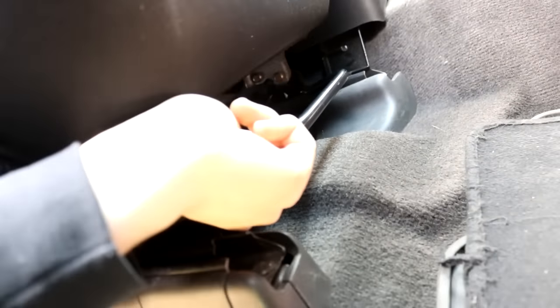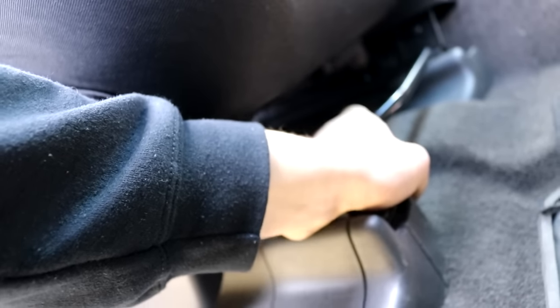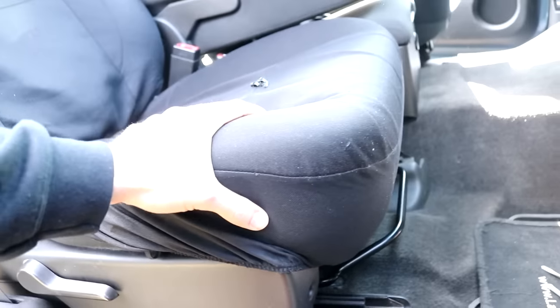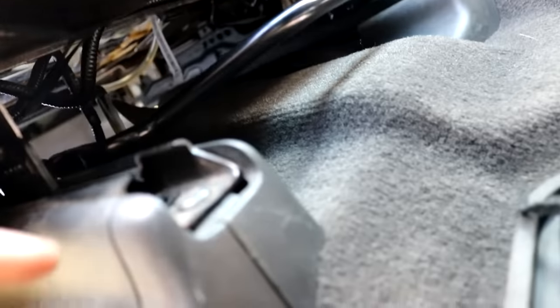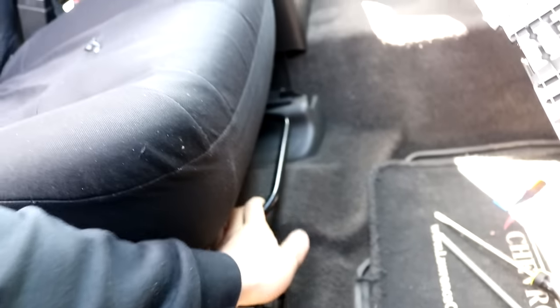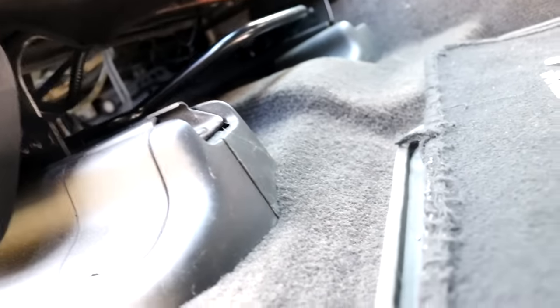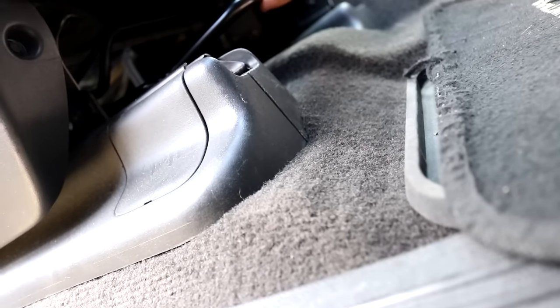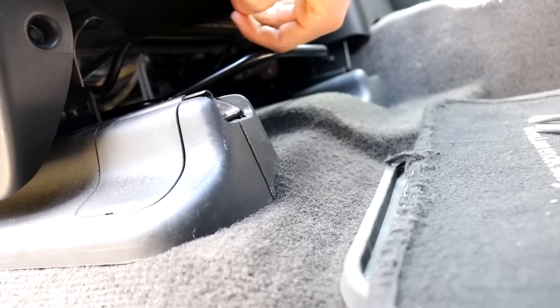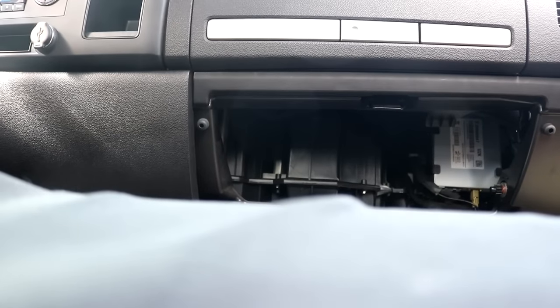That was probably the culprit. I used tape on the rods that connect the inside so they wouldn't bang against each other, but it still gives a nice tight seal. It doesn't matter if this is connected or not - this is just to adjust the seat, it has nothing to do with the integrity of the seat actually being bolted. I think what allowed this to start happening is that whenever I tied these seats down to the bar, it probably suspended it a little bit, preventing the rattle.